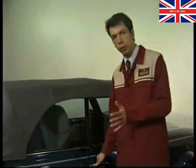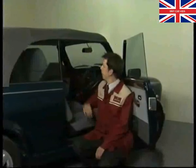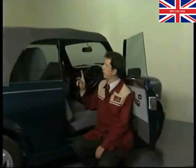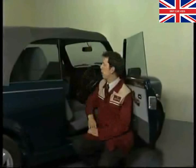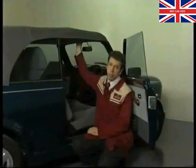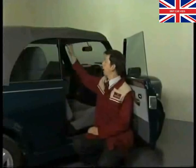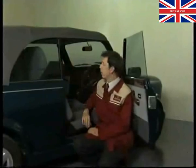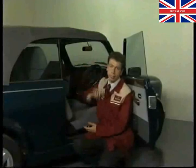Looking inside the hood, the frame features three spars spanning from one side to the other. The hood cover is bonded to each of these spars via flaps of material that hang from the cover and fold neatly around each spar. On each side of the hood cover there's a wide elastic strap pop-riveted at the header and the second two spars, designed to hold the hood cover in its correct position each time the hood is raised and lowered.